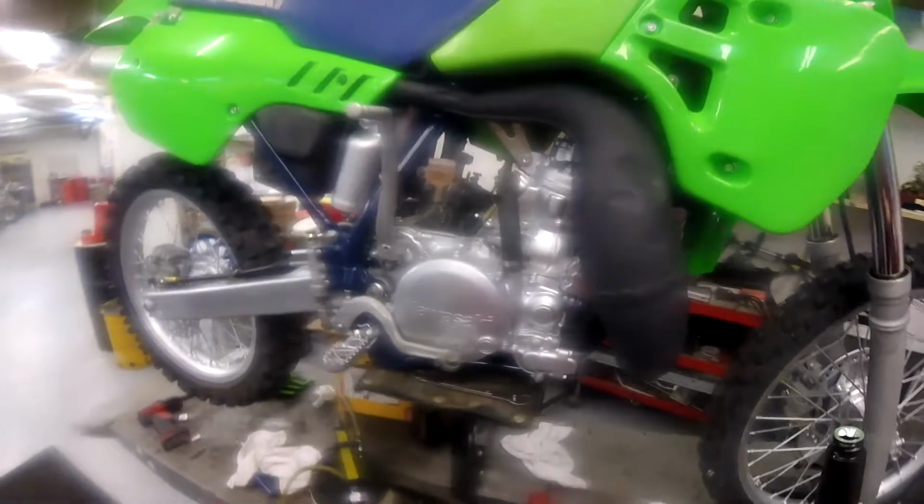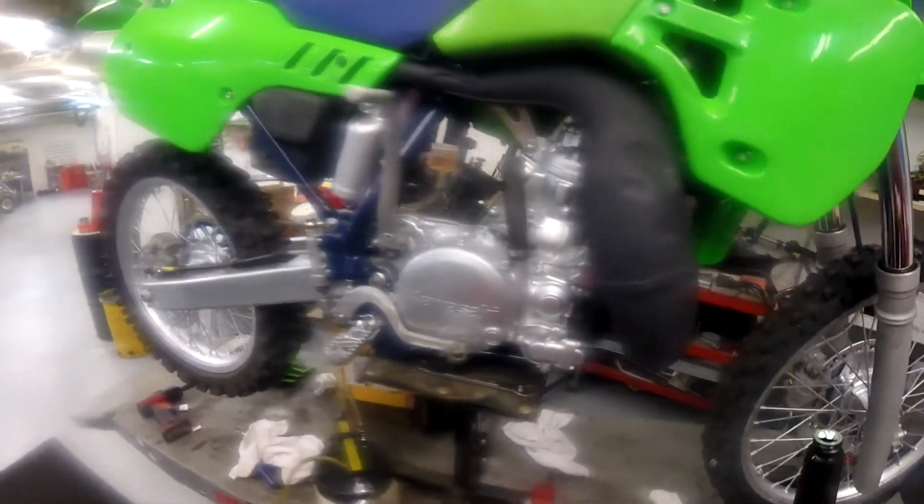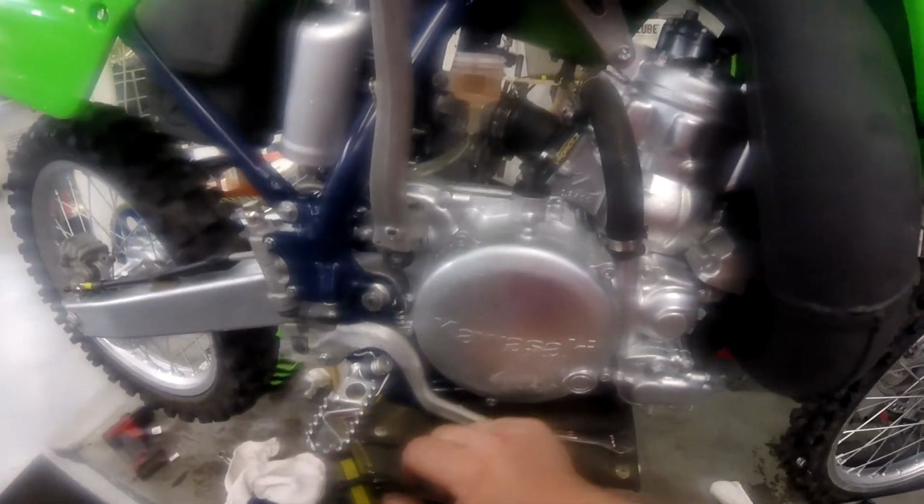Okay, you start out the same. You fill your reservoir. You let the bubbles settle. You let it get some liquid down into the reservoir. Not much flow's happening. See, that's what happens at home, guys. See that little bit of flow in that? When I'm pulsing this, that's all you're getting at home without a vacuum bleeder. That's all you get, and it takes forever to get them going. Now, watch what happens when I put some vacuum to this vacuum bleeder.